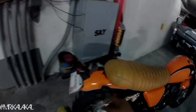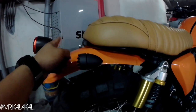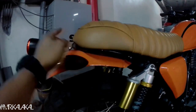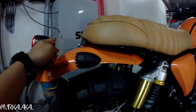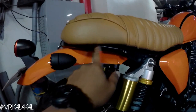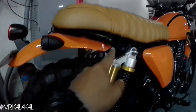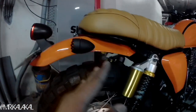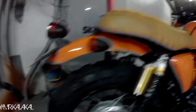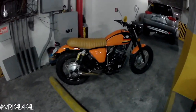The frame on this bike originally ended here. So we cut it — the seat stays the same, we didn't remove anything from the seat — but the U-bend only goes up to here. What we did with Eman is we cut it and welded a thicker U-bend because the stock one was very thin. Then the fender was also cut so we could adjust the stance. The stock fender was very long — it looked like a cruiser type. So our target style here is brat, tracker, scrambler — whatever you want to call it. I'm not sure what genre or category of custom bike this falls into.